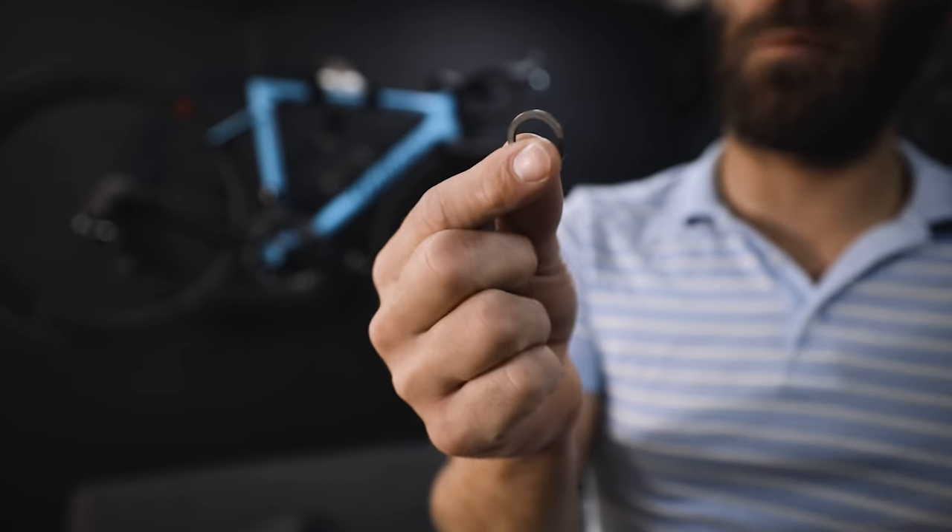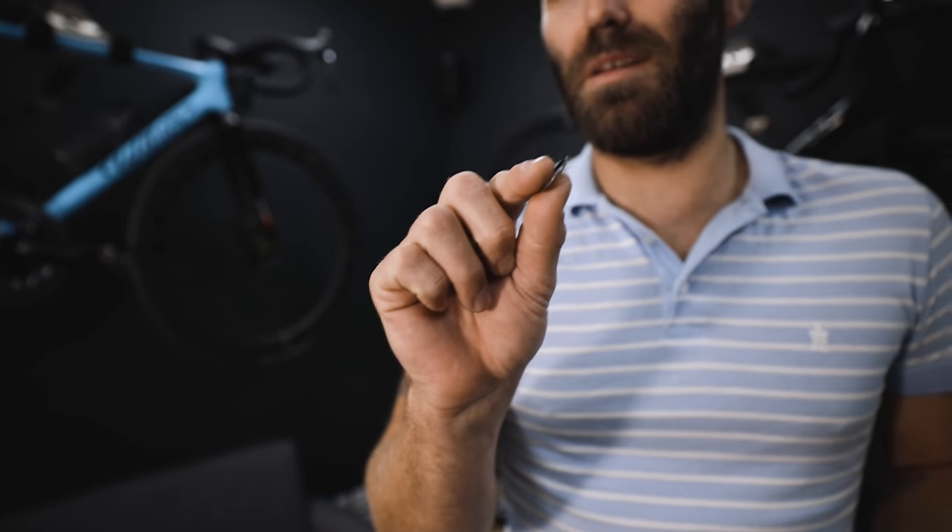Another way is washers. I use these a lot — this is a 1.5mm pedal washer, specifically designed for bike fit application. I recently made a blunder ordering custom 2mm pedal washers that didn't work. It's a relatively inexpensive way to increase stance. You can really only use one washer because you're reducing the amount of thread engagement in the crank — the exception being the Look system, which has a slightly longer axle, and Look also sells a 2mm spacer.